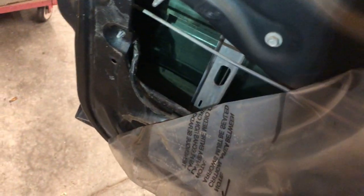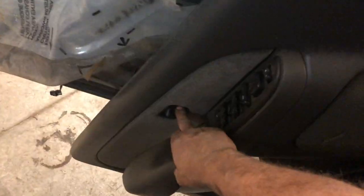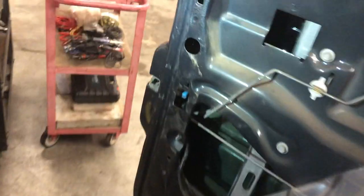So we'll open it back up. Let me pull the handle so it's all the way open. I've removed the door panel — it's just a couple of screws. There's one right up underneath here. The door panel itself slides up and over. You got one up by your switch here, I think there was only two on this one. Then it just lifts up. Peel the paper back.